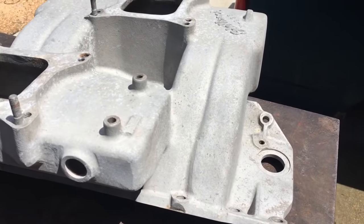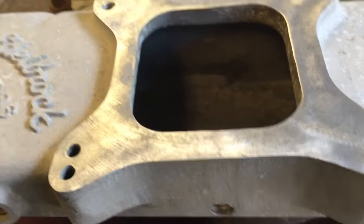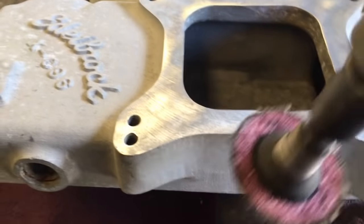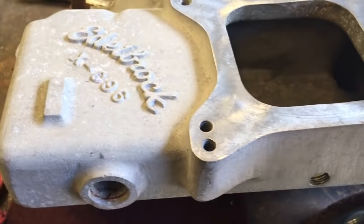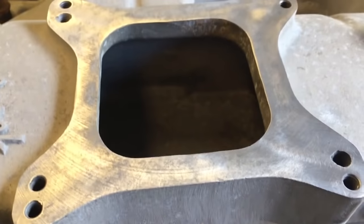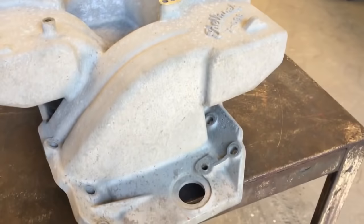It's easily touched up. At this stage, if you want to go ahead and clean up your gasket surfaces, you can. That way you can either tape them off, or if you get some overspray on them, you can just take a rag with some lacquer thinner and wipe your overspray off, and then you're ready to go — so you don't have to worry about touching the paint. Now that you've got your gasket surfaces cleaned up to satisfaction, you're going to take your Scotch-Brite pad.